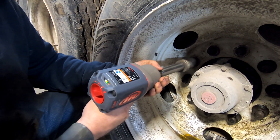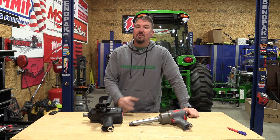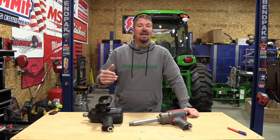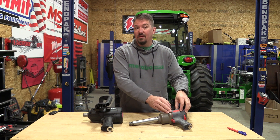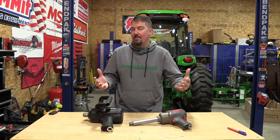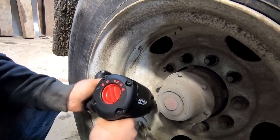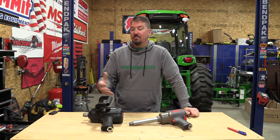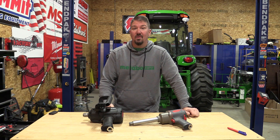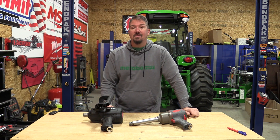Both of them have similar specs, and that's what makes it hard to compare pneumatic tools — you have so many variables in how the air is delivered. It was really interesting to look at the 2146 with the gauge and confirm it was over-pressured, and probably over-pressured the AirCat as well. But the performance was excellent. In our situation we could really use the extended anvil, but we made it work and it did quick work of a lot of things. Really nice tool for the money they're asking.